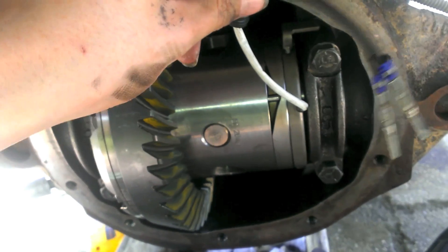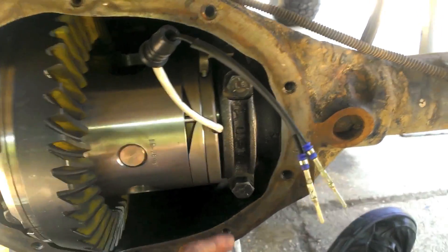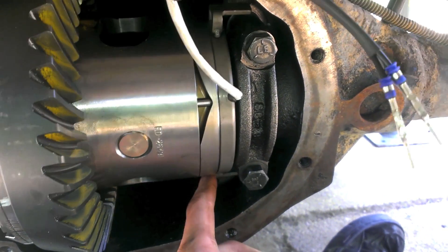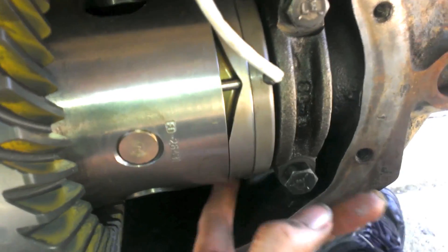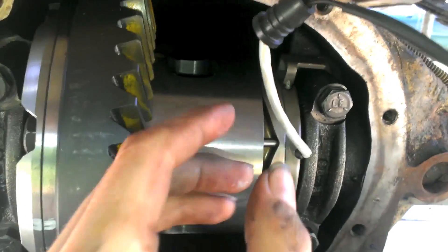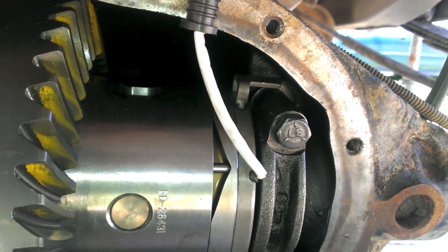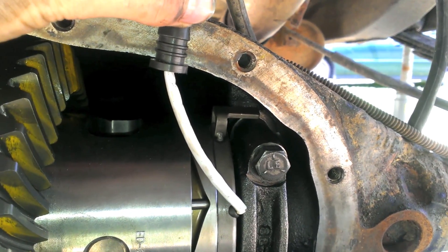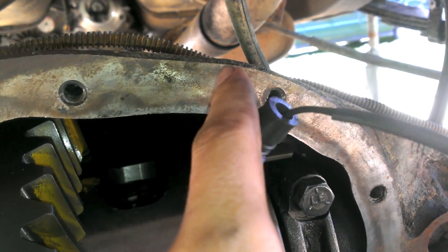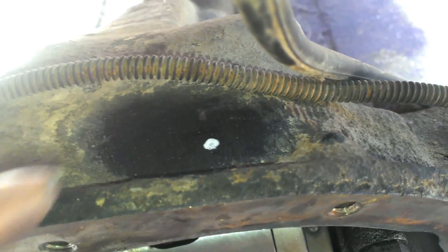Now the fun part — drilling holes. Here's your wire harness and rubber grommet; the grommet is where you want your hole. The anti-rotation tabs don't hold the stator super tight and it bounces around a bit — I tried installing it the other way and it doesn't fit, so this is the only orientation. Keep in mind when you drill the hole, the assembly will be sitting higher, so account for that offset. I'm planning to put my hole between these two existing holes, a little closer to one side and just far enough back to clear this ridge.